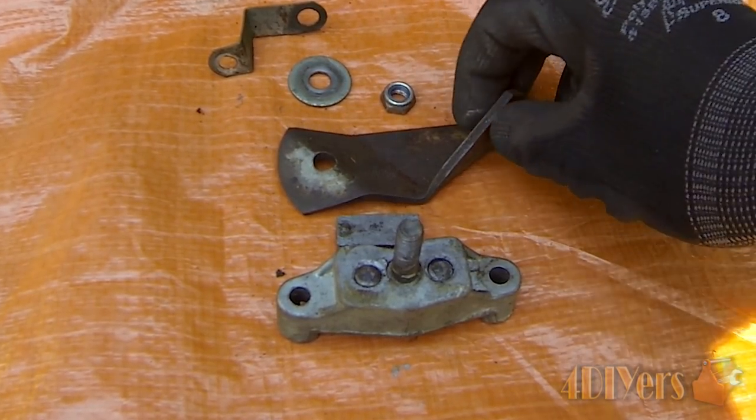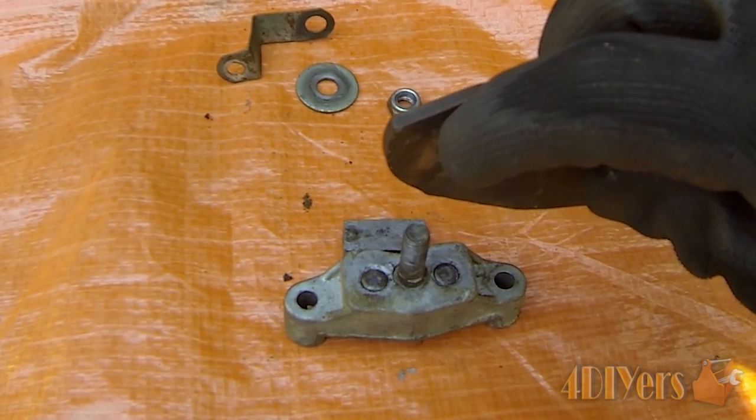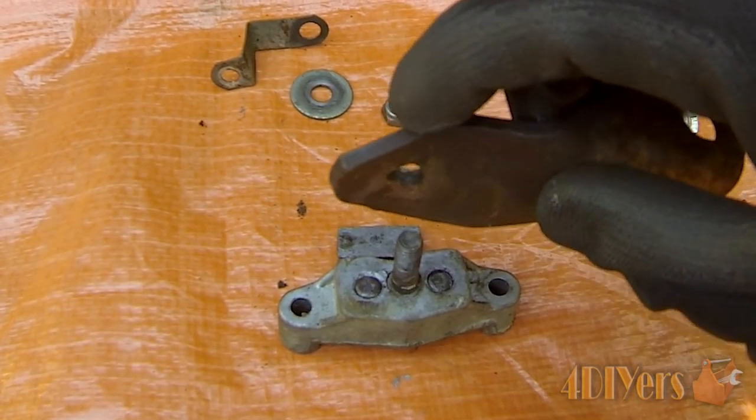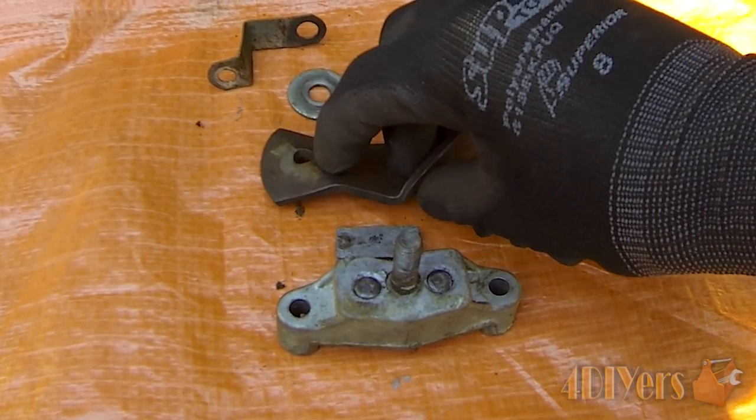As for the bracket, its odd shape is intentional — the pins sit in here at their maximum out point, and when this bracket is rotated it applies pressure on opposite ends, which in turn pushes the pad against the rotor itself.